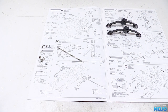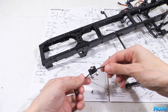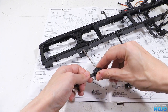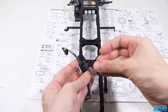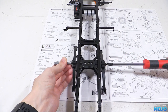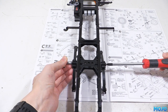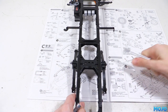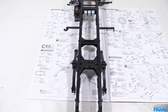Complete both spring packs and we can mount them to the chassis. We need to pop in a top hat bushing into the hole in F2 with the flange outwards. Slide in the long screw and pass it all the way through the chassis and the cross member, and on the other side we need the other spring pack and the bushing. Then we use a nylock nut to attach it. The nut doesn't need to be all that tight — just take up the slack plus a little bit extra. It can be quite difficult to feel when the nut is tight with the super long screw, so be careful. The two leaf springs should swing nice and freely; if they're binding, find out why before moving on.